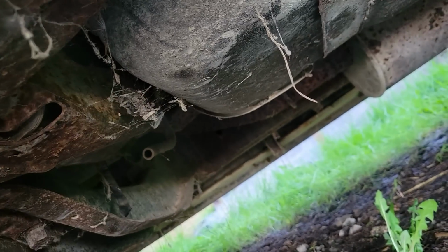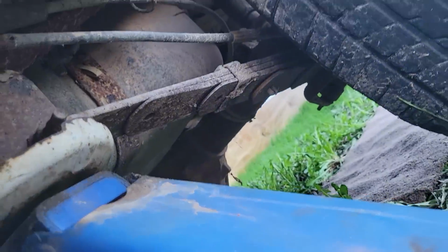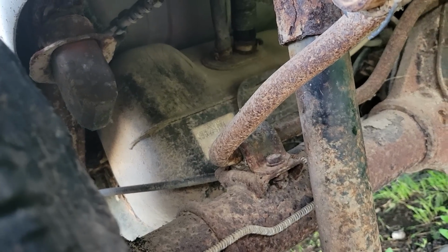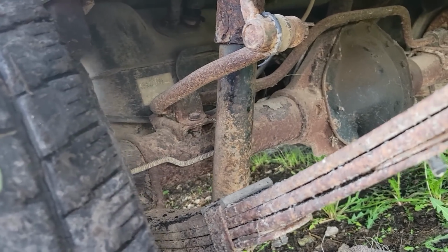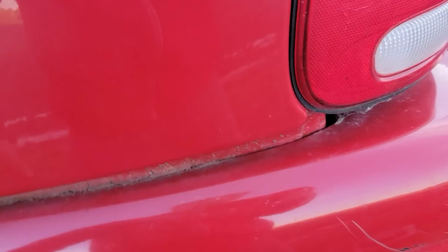I'm under here and I got my jack stands and my jack, and I'm starting to look under here. And so to get to the fuel pump, you gotta take the tank out. You got to remove, I guess, an evap hose off the charcoal canister. You move it off of the charcoal canister and it goes with the tank. Then up there you gotta remove your two vent hoses, which are right there, your vent and your fuel in. Once you do that, you gotta remove your straps, which are 5/8 nuts, right back there if you kinda see it above the parking brake cable. Both sides, lower the tank, unplug the fuel line, unplug the connector, pull the tank out, change the fuel pump. I might show that a little more, but that's what we've got ahead of us here.